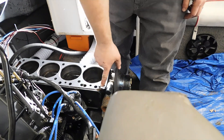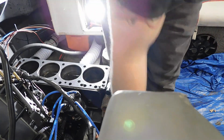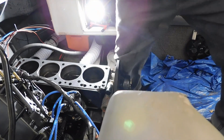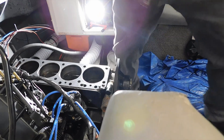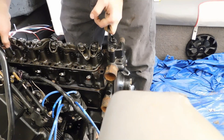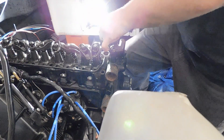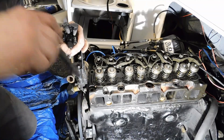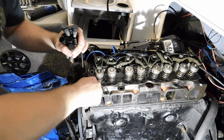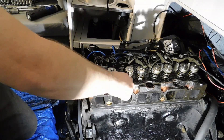When you're lifting the cylinder head in, you're going to have these guide pegs — there's one here and one in the back. That's going to be your friend for lining up the head. Take your time, it's not a race. Now that the cylinder head is on loosely, go ahead and get all your bolts in a few threads so that you know everything is lined up good, and then just make sure they're in by pulling up.